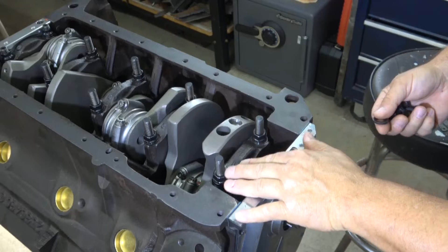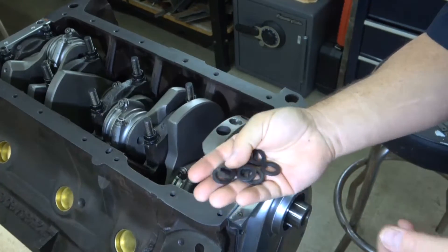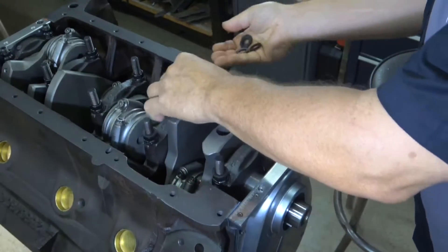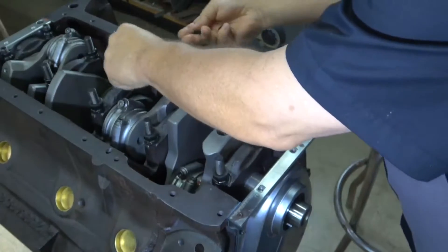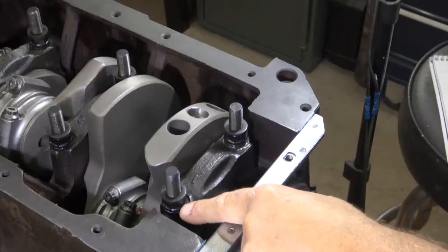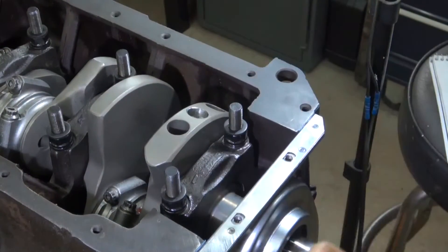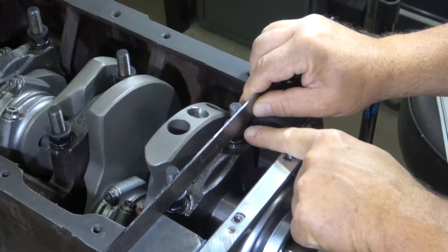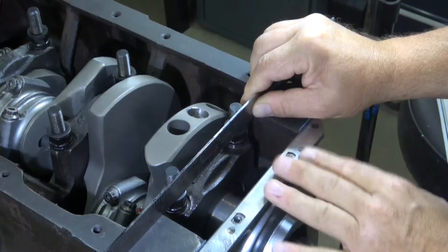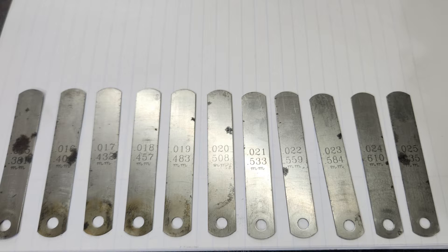This particular girdle, since I have studs and the nuts are well below the oil pan rail, you start by putting in these washers. These come with the kit and it says to put all the washers on all the studs. This will be the starting point for the measurements we have to take for the shim pack. It only goes on the first four main caps. Since all of the nuts are different heights, we need to get them even with the oil pan rail all the way across by putting a straight edge across the washers and measuring the gap between each washer and the straight edge for all eight positions on the caps.